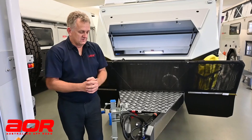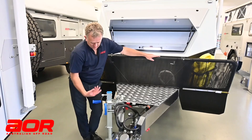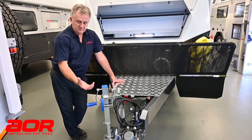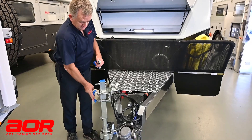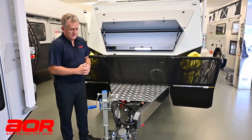That's basically your hook-up. Once hooked to the vehicle, the jockey wheel has adjustments — not only winding it up and down, but also a lever off the back edge. I can pull that out and slide the jockey wheel up and down. When it's on the vehicle and we want to travel, we swivel that whole wheel up by pulling the handle around, lifting the wheel up, and letting the handle lock back into itself. The handle comes off — don't leave it on because it won't be there next time. It is magnetised, but it's meant to come off. It locates in on its own when you need it.